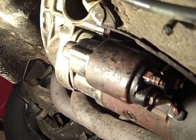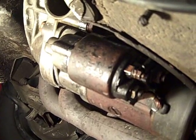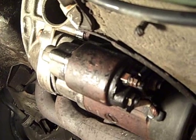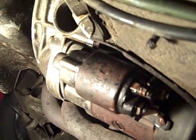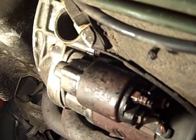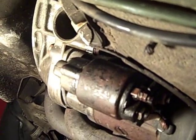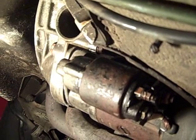But so we've located top dead center. So now the next step is taking off the starter and accessing the flywheel cover in the back so that we can go ahead and put the flywheel lock on. Obviously at this point we're under the car, and we are going to go ahead and take the starter down now to put the flywheel lock on. We've got the engine at TDC on cylinder 1, and we're up underneath.